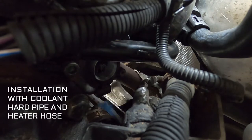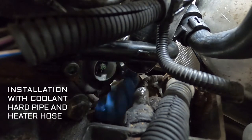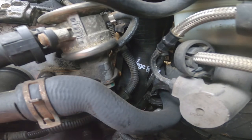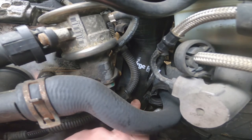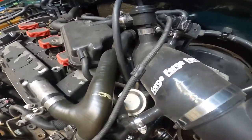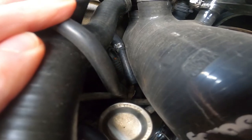As I mentioned earlier, I want to keep this video strictly to how to install the pipe, but the interference with the hard pipe and the heater hose is an installation problem, so I do want to touch on that quickly here. You can see in this clip that towards the back of the heater hose it contacts the inlet pipe, and the coolant hard pipe also contacts the inlet pipe. I even bent the coolant hard pipe a little bit to get it to fit better and it still contacts. In addition, the hard vacuum lines up and around the combi valve also contact the inlet pipe — I had to bend those a bit as well — and you can see the little piece of heater hose I stuck on there so that if it contacts, it's not going to rub through the inlet pipe.